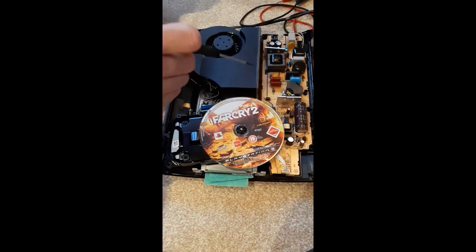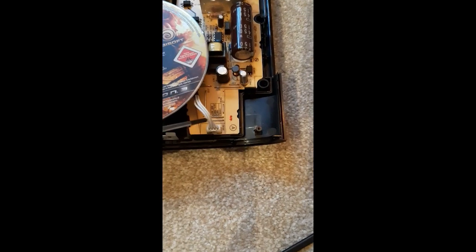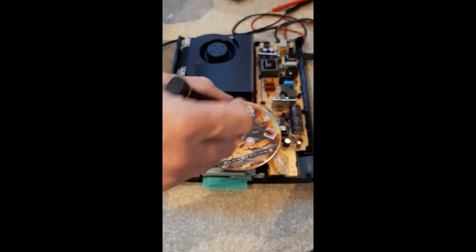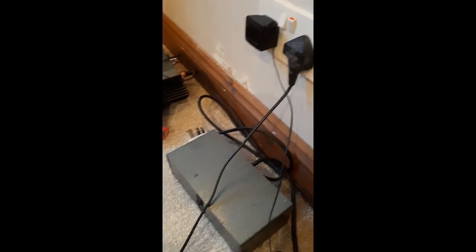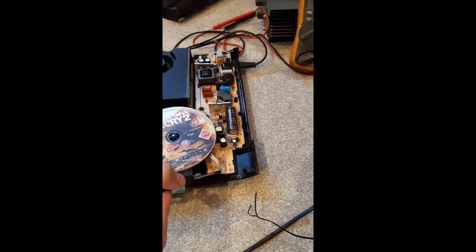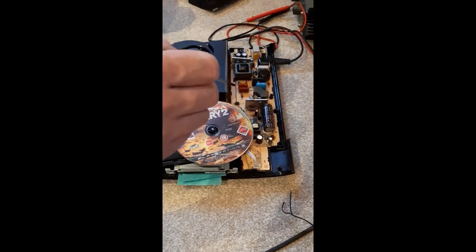There's something wrong with the power feed into the PlayStation. What I was going to demonstrate was that this five volt feed here was dropping off. I thought the five volt feed is dropping off and therefore shutting down the power supply and the 12 volts, and that was shutting down the PlayStation. What I did to fix that problem was I had a mobile phone charger which delivers five volts, snipped the end off the terminals, and put the ground and the five volts into the ground and five volt terminals here. I powered up the phone charger first, then powered up the PlayStation, pressed the green button, and the PlayStation was running lovely.